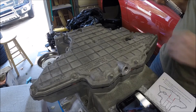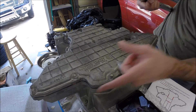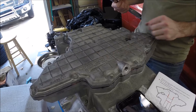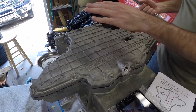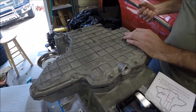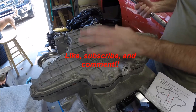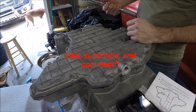There we go — I got the lower oil pan on, properly torqued. Just make sure you go around and confirm the gasket looks like it's properly seated and sits nice and flush. And that's how you install your Improved Racing Batwing oil pan trap door baffles. Hope this helps — look forward to hearing how this installation goes for you. As always, please like and subscribe if you found this helpful, and we'll look forward to seeing you next time. Thanks for tuning in.